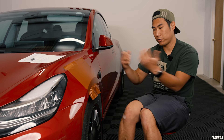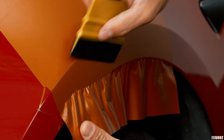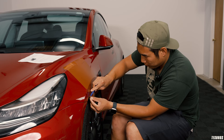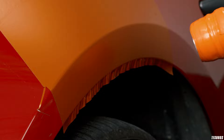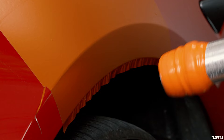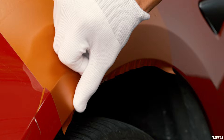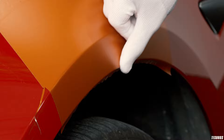All right, let's keep doing this. This is not a great knife, and this is where you would want to heat some. I would be using like a wrap glove or something like that to do this part if you were going over the edge. And when you do this part, same thing — go really slow. Do not go fast on this because you're going to get wrinkles right in the edge, and you do not want that. So once you get to the edge, go little by little.